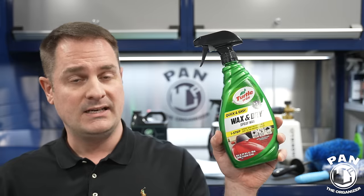Next, let's talk about a drying aid. Once you're done washing and rinsing your vehicle, you spray what we call a quick detailer on the wet surface. It does double duty — lightly protecting and boosting gloss and slickness — but mainly adds lubrication between the paint and your microfiber drying towel. There are usually two places where marring is induced: the contact wash with your mitt and the drying stage with your towel. Using good lubricants in both stages minimizes those chances.